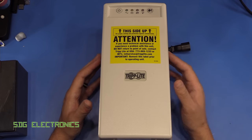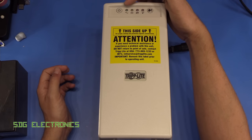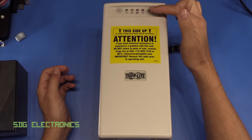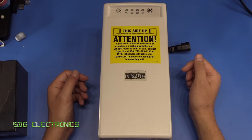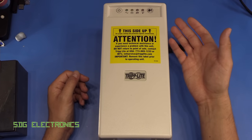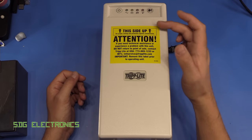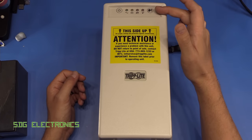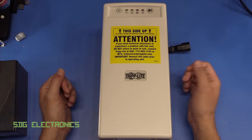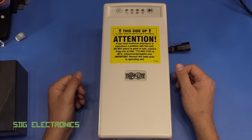In addition to that, there are some things around alarm systems. On the front of this device we've got four LEDs and an alarm built in, as well as a mute button. That forms part of the medical regulation. In the event of a power outage, it will give an alarm which you can mute, and it'll come back after a few minutes. In the event of a critical battery, that alarm will indicate a slightly different tone to alert the healthcare professional that this unit is about to fail.